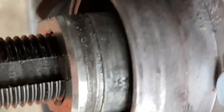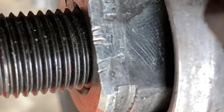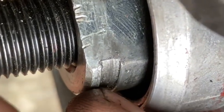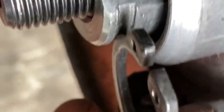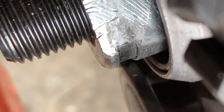So I took it back apart again, and you see that's the little groove where the clip rides in. And I think it just got worn out. I don't know what happened. Like it started spinning or something. Like you can see there, it's not very deep. That clip kept popping out. It was able to pop from inside there over. And I'll show you how wide that track is compared to the clip. If you can get it to focus, yeah. It's a lot of play room. So I don't know if the edge got ground down by maybe the clip twisting on there. I don't know.